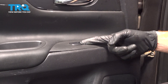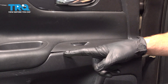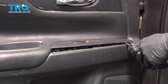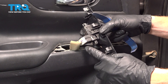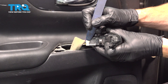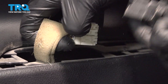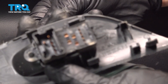Let's move down from there and continue along the window switch. You'll find a plastic panel that makes its way around this area. Use a plastic trim tool, make your way under here, and gently start separating this. Underneath this area, you will find one wiring harness — we will have to disconnect that. There's one locking tab right in the center; press that in and then separate the wiring harness. We'll give each side a quick check for corrosion. Assuming those look good, we can set this aside.